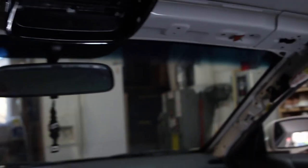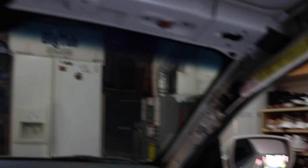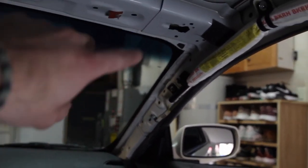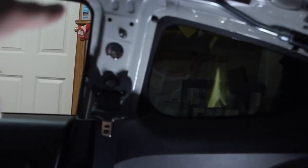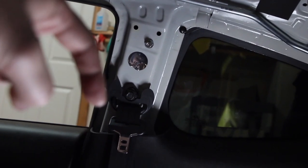Removing the pillars is a little difficult, but we've already done it. Pretty much all these pillars have only one screw on them — it's a 10mm. The front pillar covers have one Phillips screw on each side, behind the little SOS clip. The rears and the middle have two 10mms, also underneath the SOS clips. Pop out the little clips — they're easy — and there's a 10mm on each side. The bottom ones are stuck in and you wiggle your way up. They have a bunch of clips in them.